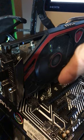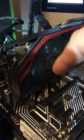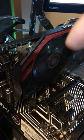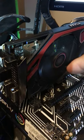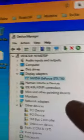All I have to do is go into display devices and Device Manager, go to the display adapters, and disable the Nvidia card — the GTX 760. And then I can use this, and here's what it looks like. The screen right there — I go in here, and it's disabled right there, and that's all I do.